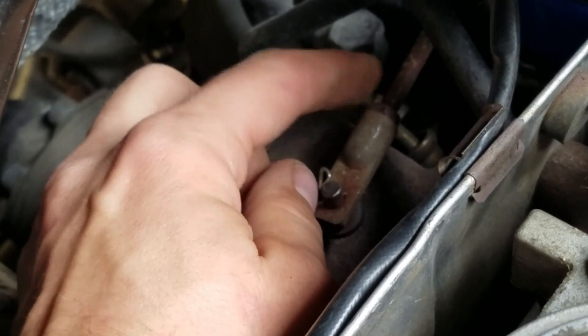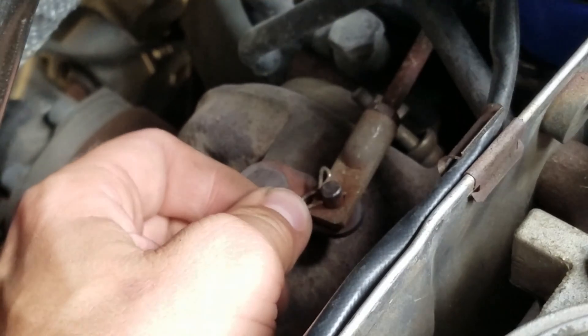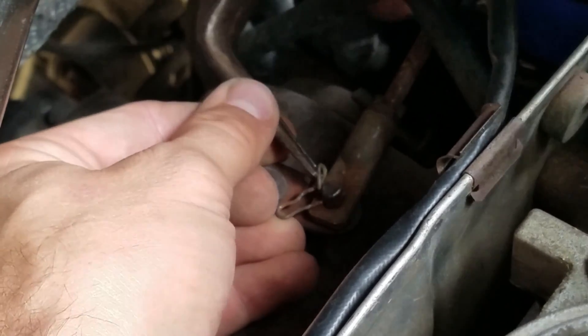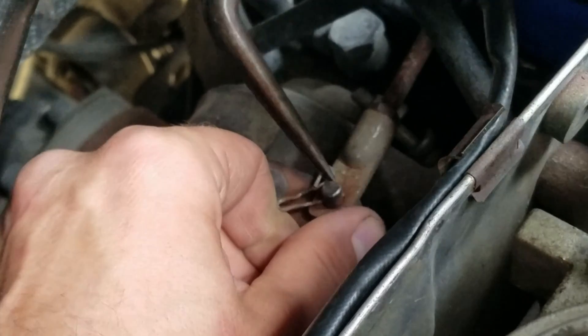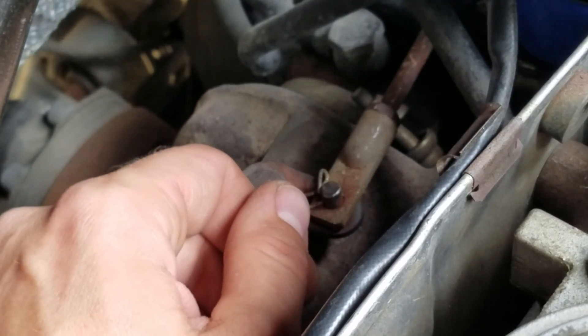Set your rod back on the little keeper, put your pin back in place, and then just tighten down your little jam nut — and that is it. That is all there is to adjusting the wastegate; it is pretty easy. There are multiple different reasons why you might need to do this: if you have a wastegate spring that's getting a little bit loose, or you're trying to diagnose something. In this case I'm doing some tuning on this car. I hope that helps you guys out — if you have any questions put them in the comments, thanks for watching.